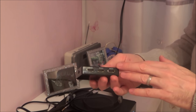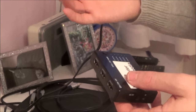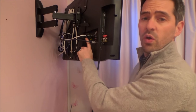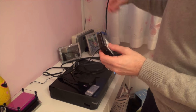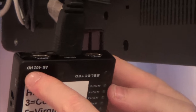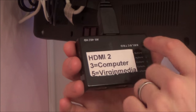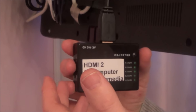This is all cheap stuff from Amazon and eBay. It only goes up to 1080p, but that's fine — that's all I need. If you had a 4K TV you'd need a different switch, but you can't get anything above 1080p on these adapters anyway because VGA only goes up to 1080p. This one here is a five-input switch — I'll connect the output from the switch into the VGA adapter. If you only want to spend £3 you can get a three-input switch, which is even cheaper.